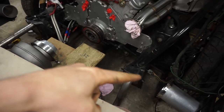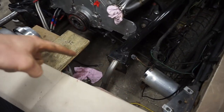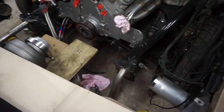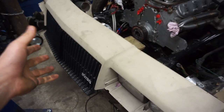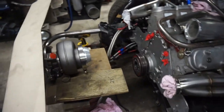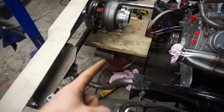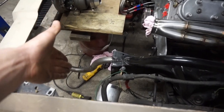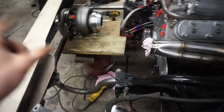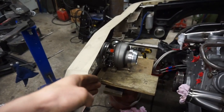I was originally going to make a triangle off of the frame to mount the turbo and then just kind of build some legs off to mount the rad. But with that, I still have to mount my bumper and everything off the front of the car as well. I ended up coming up with this design here. I just bent it so the tube goes in underneath the rad — that way the rad sits down there. I'll build a mount so the rad can sit on it, and then I'll have to modify my upper support there just to mount the top half of the rad onto it.